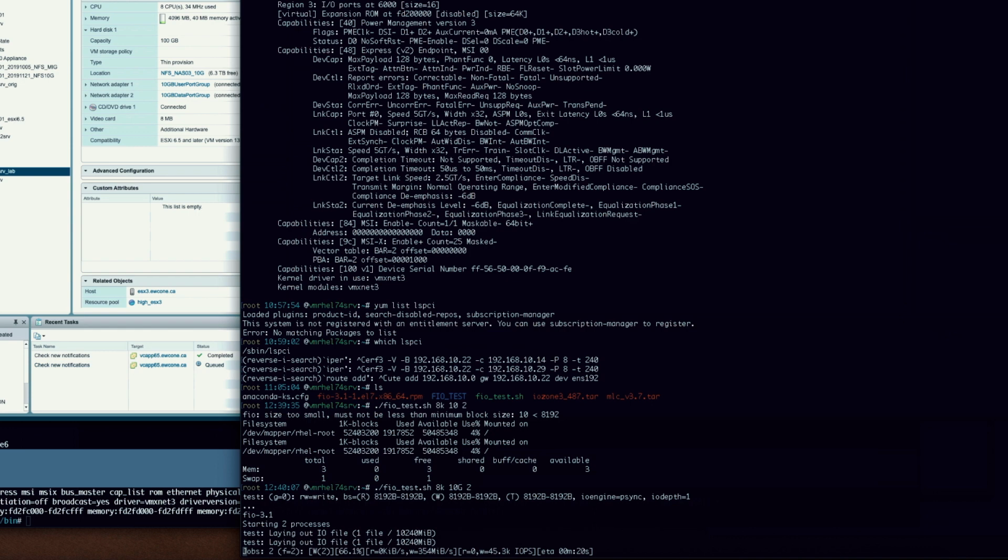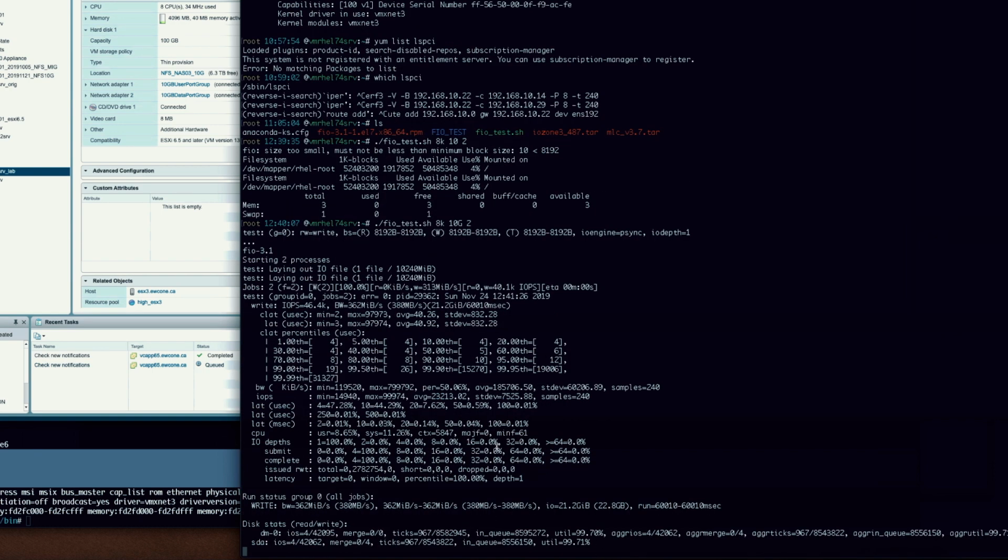But what I noticed in my test here, with that particular setup, is that the 8K block size gives you slightly higher throughput than anything else, and 256K will give you slightly less throughput, and 64K would be somewhere in between. Alright, so let's get that test finished. It's going to go 2 more seconds, 1 second, and here it is.